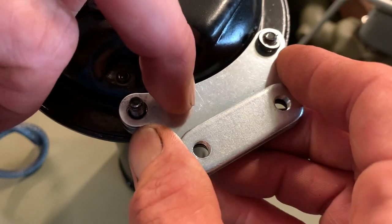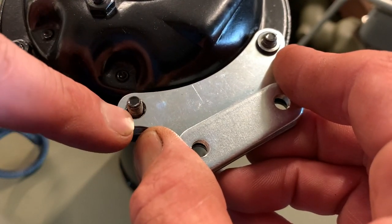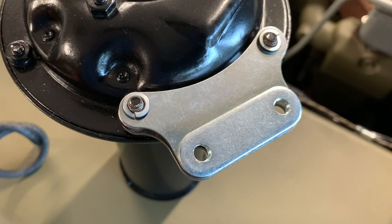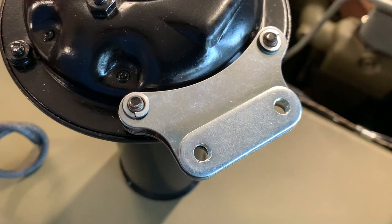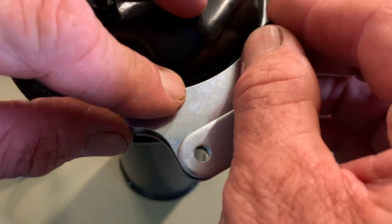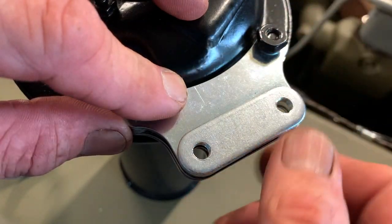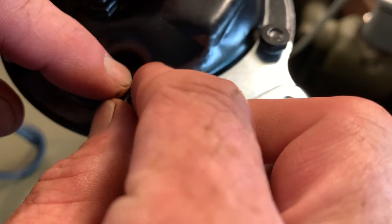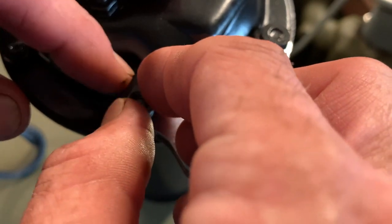We'll get all these plates locked in place — it takes a little manipulation, but you just need to line up all four holes and snap them into the raised surfaces on that specially milled washer. The next step is installing the lock washers and nuts onto the studs. Make sure everything is in place and the plates are locked into the sleeve before installing your fasteners. I'll tighten them to the point where nothing can jump out of order, but leaving a little play in the bracket before mounting it to the main bracket on the body tub. While installing these fasteners, I want to share some research: the most popular explanation for the horn vibration bracket is that it prevents vibration from going through the entire side of the Jeep body when the horn sounds — which would be loud and annoying. A second explanation is that the bracket achieves optimal decibels when you press the horn button, and that one makes sense to me too.